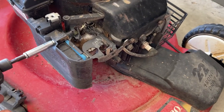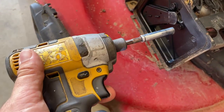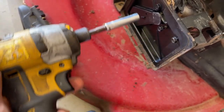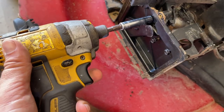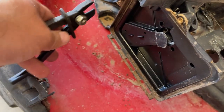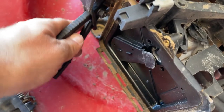What we're going to do first is pull off the airbox. I've already gone through and serviced this machine, but I've not messed with the carburetor — I was saving that for this particular video. Before I forget, I've got my fuel line pinchers here. Find a good spot on the fuel line.